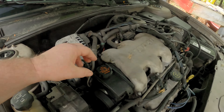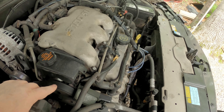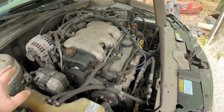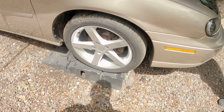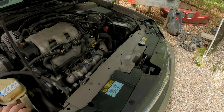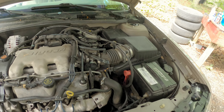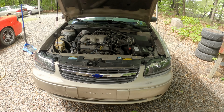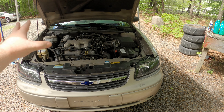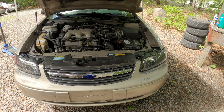Because we need to move the power steering pump, we're going to be pulling this belt off and we'll also replace the belt while we're at it. It's going to be a long day - there's a lot to do. Step one: we've got it up on ramps because I'm not going to need to get the wheels off but I want it up higher where I can get to it easier. So step one is drain the coolant, because if it's not drained it's going to make a big mess and you're going to dump coolant in your oil, which we want to avoid.